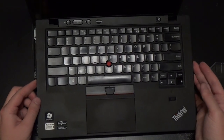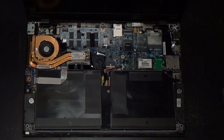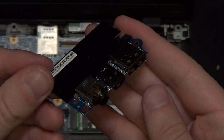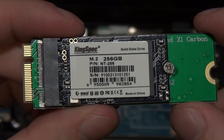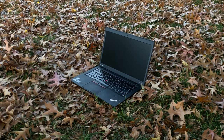After removing a few screws and the keyboard assembly, it's right there. In traditional ThinkPad fashion, many of the internal components are easily accessible and can be replaced with relative ease. Like with all ThinkPads, Lenovo has service manuals available on their website, as well as the necessary information to get replacement parts. The keyboard, touchpad, fingerprint reader, ports, display, power jack, cooling assembly, and SSD are all user-replaceable to some extent. RAM is unfortunately soldered on, and it's probably the biggest bottleneck for this machine when it comes to upgrades, but this is just a fact of life with thinner laptops. The entire X1 lineup, aside from the original 2011 model and the Xtreme series, all have soldered RAM.